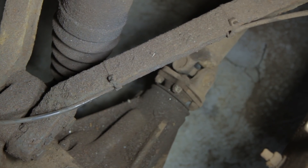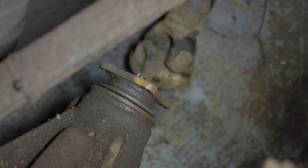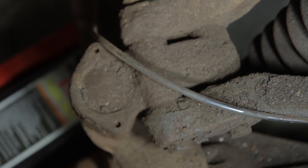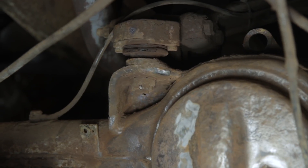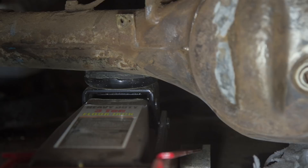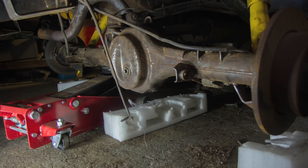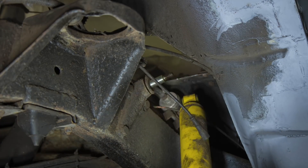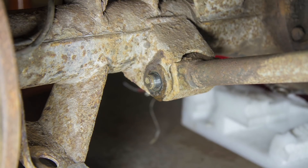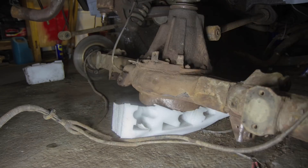The last thing was the prop shaft. I had a bit of a weird problem — the car was in neutral, the transfer box was in neutral, and yet this prop shaft didn't want to spin freely. I kind of forced it — I really hope I haven't done any damage, but we'll find out. Both of the axle ends were free, so it wasn't anything to do with the differential. This axle is coming out of the car. This is the ball joint on the A-frame — it's the second last thing holding this axle on the car. I released the castellated nut off the ball joint in the centre and the last things holding this on are the two trailing arms coming off the chassis. Both dampers came out. Big robust engineering — even with rust, this stuff always comes free, which I really love. I was able to slide the axle out from underneath the car. Next time we'll get into cleaning that up.